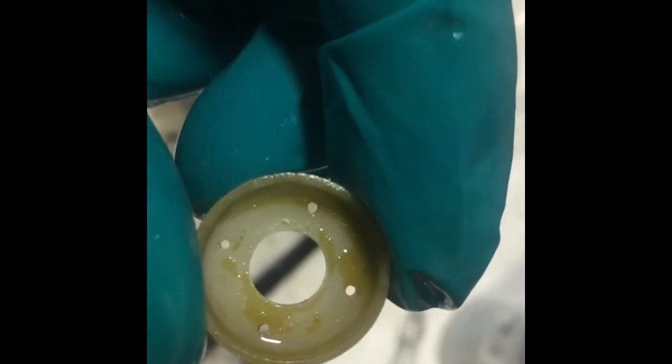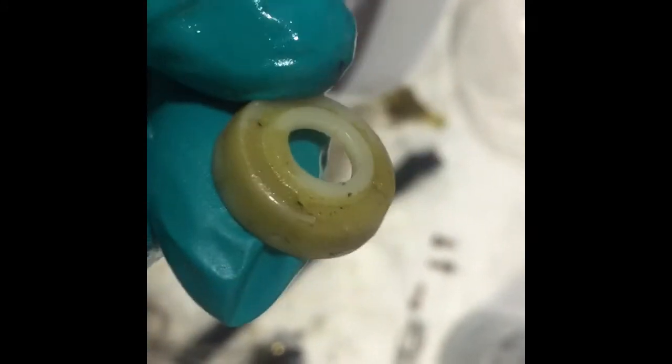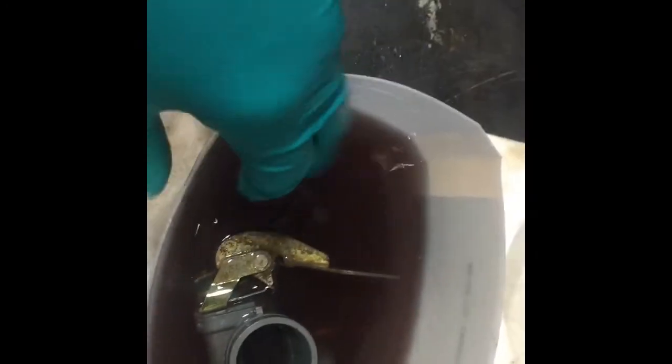See that — that's the varnish I was telling you about, and it is sticky stuff. It would not come off — I just scraped that off with a screwdriver, and that's after soaking it in Sea Foam for a while. The Sea Foam didn't even really soften it up. So just throw that in there. It looks like pretty decent stuff — I can see a film of oily residue in there, which is probably the varnish coming off.